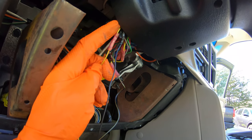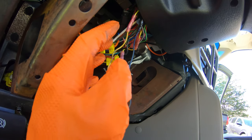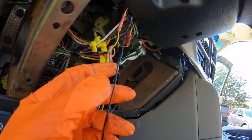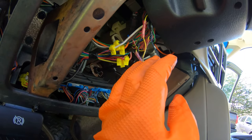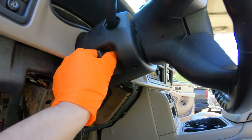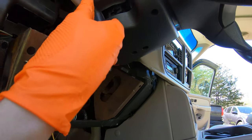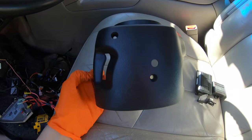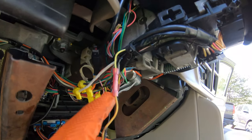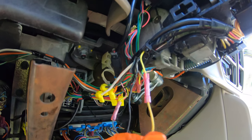You can see these buck connectors with a yellow wire coming out of here and a yellow wire coming from down here — these are likely the pass lock module wires. We're going to cut these buck connectors off, solder a wire between them, and cut out the remote start wiring. This black wire looks like it was just tapped in incorrectly — they tapped the wrong one, taped it up, and tapped the other one. There were also supposed to be two screws in the column cover and they weren't there. A lot of these alarm installs can be shady.